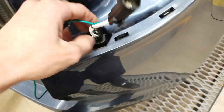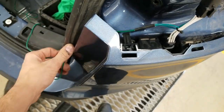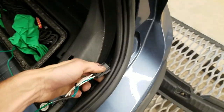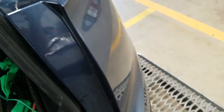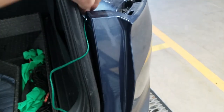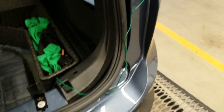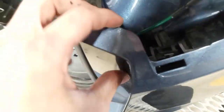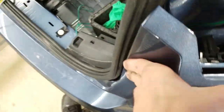You're going to plug in the other side. What I did was run that wire down in between — pull this trim up, slide the weather strip, run it through there, and then plug it in. Then you hide the wires in between the body so the customer doesn't see it, more appealing to the eye. Once it's all hidden, pop the trim back into place like so.